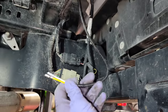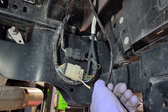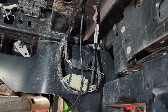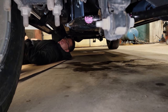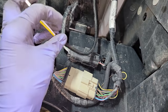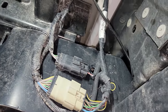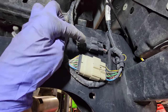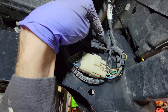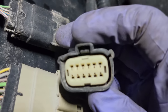The second-to-last thing we need to do is install these two pins. We got a ground and power for both our lights going into this factory connector. On this side of the harness the wires are already there; on this other side they are not - that's why we're adding them in. Here are the wires we're plugging into the harness. We are going to disconnect this connector and wait for further instructions. Connector disconnected.